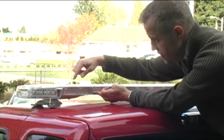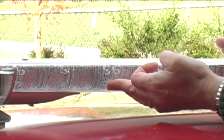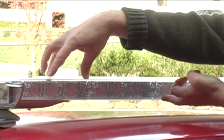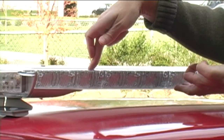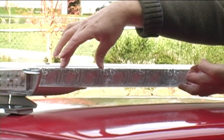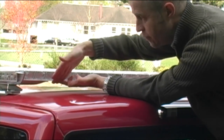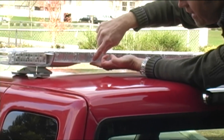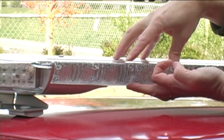Looking at the back of the light bar, there's a series of LED modules going across the back. This bar, by the way, comes in a variety of different lengths. In this particular array at the back, there's a very unusual optic design developed by SoundOff that spreads the light with the diodes inside. There's a total of six deep dish diodes in each back module, and the same arrangement continues across the bar — and the same on the front as well. The rear modules are sloping downwards, and the diodes are rear-facing. What's happening here is that the reflector is built into the actual lens, which is a somewhat unusual design that SoundOff have put together.